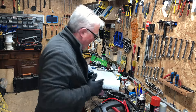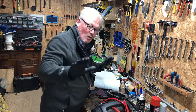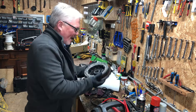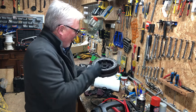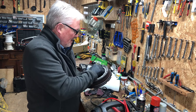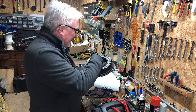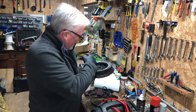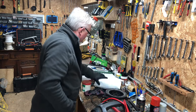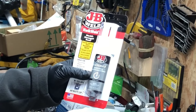So the starter motor is now fully refurbished, repaired, restored, cleaned up, greased and lubricated. I also cleaned up this flywheel - it weighs a ton - but unfortunately two of the magnets have come out. I've got to take the magnets out, clean the old gunk off the back, clean up that area, and stick them back in with some JB Weld quick weld.